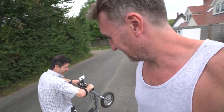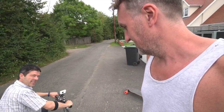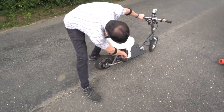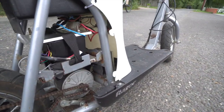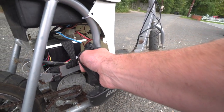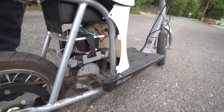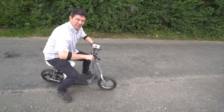Just discussing how to make it quicker. But it's a brush motor, so you could make it faster. The controller is the problem. I think the controller's down there. There's a little tiny controller just in there. It'll get red hot. I bought this a couple of years back, about 30 quid with a couple of knackered lead acid batteries. They used to sag and weren't very good. So lithium in there goes like stink. It's a neat job, I've got to say.